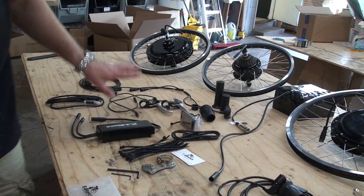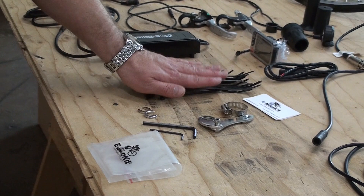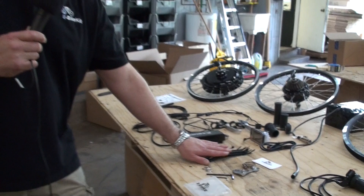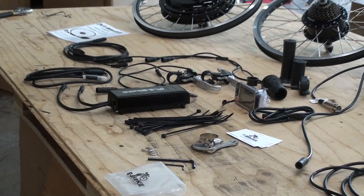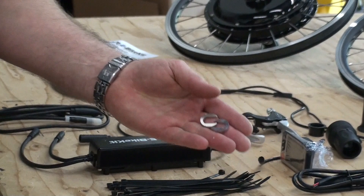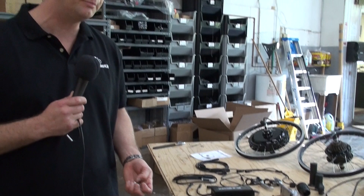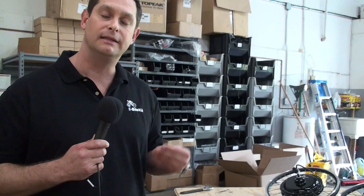Both kits — the E-Bike Kit and the Tri-Kit — get the small parts bag. Inside, we give you everything you need so there are no trips to the hardware store. You're going to get 15 high-quality zip ties — they won't break, they're not from China. You'll also get some business cards because you're definitely going to want to refer our product to your friends. You get a torque arm for adding additional security to the axle into the dropout of your forks or the rear of your bike. You also get C-washers, which are unique to electric bikes — they go over the hub motor axle, which is a little thicker than a normal bicycle axle, and they're used to fill the indents on quick-release dropouts. Whenever you do an electric bike conversion, you want to make sure everything is flush, tight, and safe. You also get a couple of wrenches — one for your brake handles and one for your throttles.